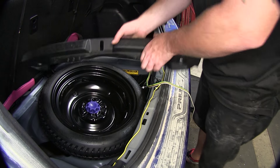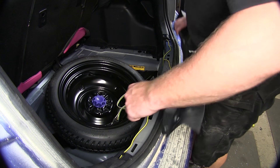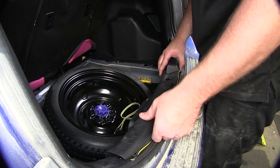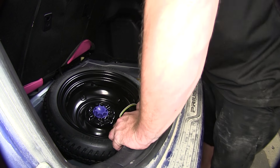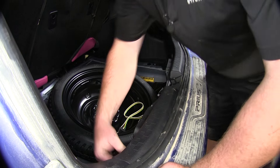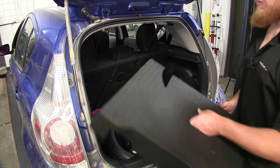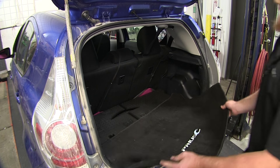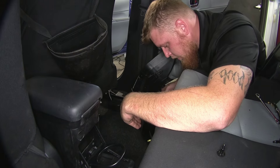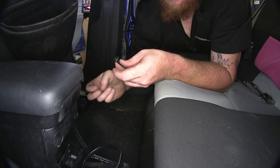The next item to replace is the threshold over the back. Make sure that we have our 4-pole down towards the center and our wires not in the way of the clips that are going to snap into place. With our kick panel back in place, we'll reattach the fasteners and press them into place. Replace the rear pads above the spare tire and the floor mats. Take and reattach the fasteners and the clip points, then work it back around in the opposite direction you did before. Reattach the two fasteners and clip them into place.